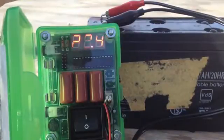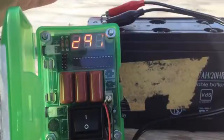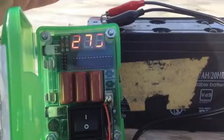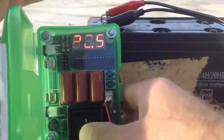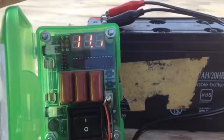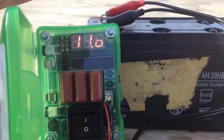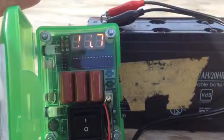We're down to the 20 to 30 volt range right now for this battery recovery, which is pretty good. The resistance is still very high after even 15 minutes of letting it sit, so I'm going to have to let it keep charging. But we can turn off the charger and see what it drops to — it's sitting at about 11.8 volts right now, 11.7, and it'll keep dropping a little bit. We can check each cell and see which might be dead or weaker than others, and get an idea of how the battery is doing out of its six different components.